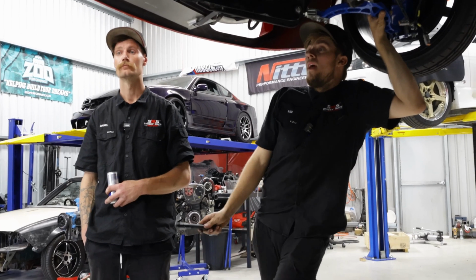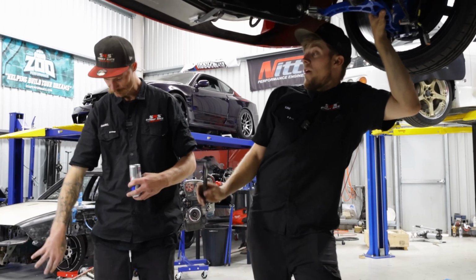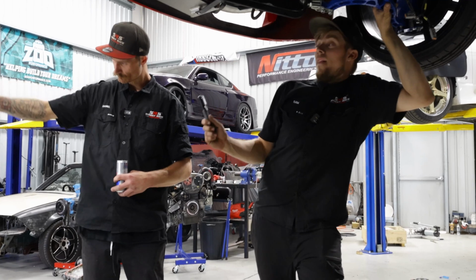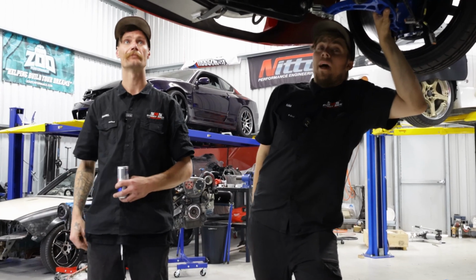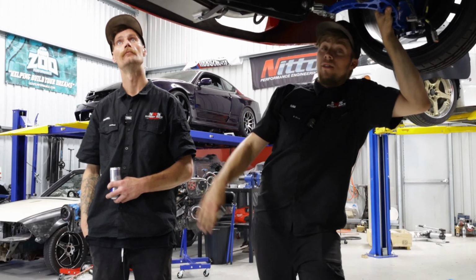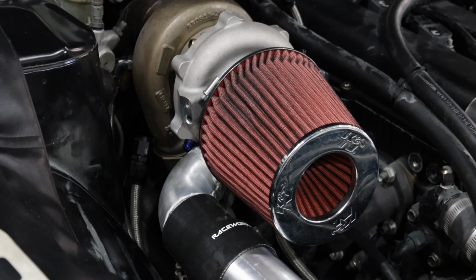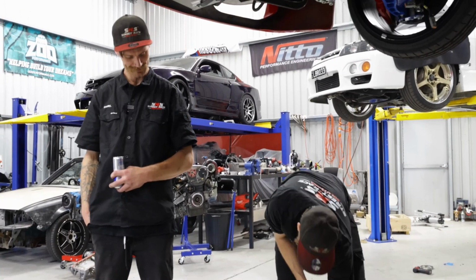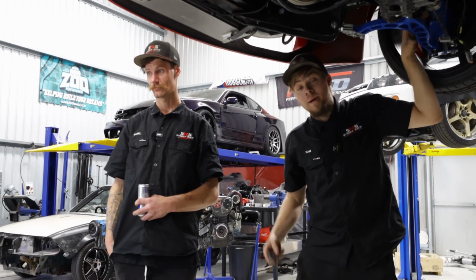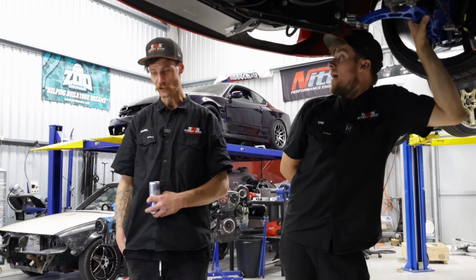They also picked up the silver S15 while they were here. That thing rolled off the dyno at 580 horsepower-ish at about 20 psi. That turbo's just too small, it's completely maxed out, that's all it's got. I believe it was tapering from like 28 to about 20 psi. The turbo's just had enough. It's only a G30 660, very small, and pretty much needs a bigger turbo. It will be responsive, but that little thing will be working its little heart out. She's running well.